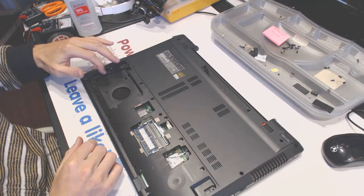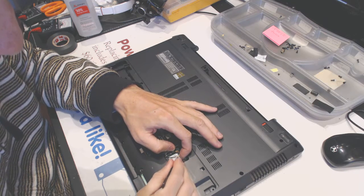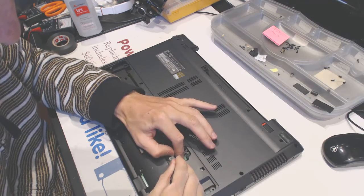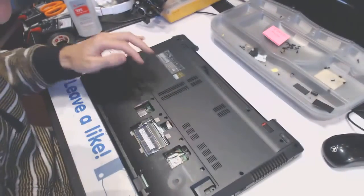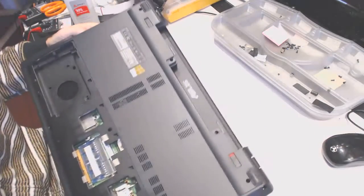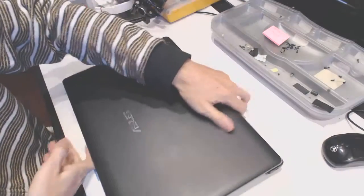You have to pull out the hard drive to the left. I will show you how I'm going to assemble it once I assemble it together. You don't need to disconnect those cables right here. I mean, we almost always disconnect because we think that we need to, but no, don't disconnect those wireless cables for the wireless card. Here, let me plug them back in. Okay, so that's plugged in, and the CD-ROM you have to remove after you take the top off. So basically screws here, here, here, all of those you remove, all right, and then you flip it over,